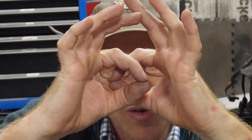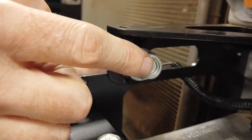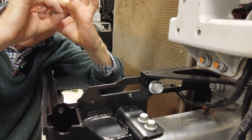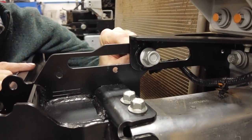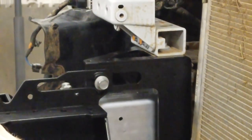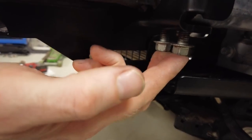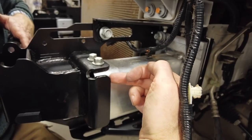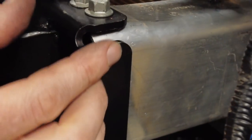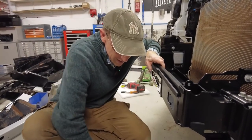Put a little screwdriver between the can and the end flange just to give a little room — that might be a tip for someone. It lined up pretty well. Now we're ready with the bolts — B1 and J1 — big nuts and bolts, no extra washers needed. These bolts went from the inside out. There's also a vertical one that goes from the top down — make sure you don't get it in the slot, you've got to get it through the little overlap where the two slots meet.